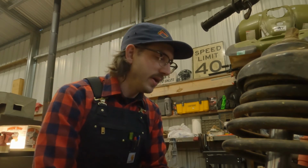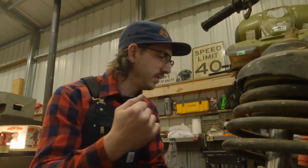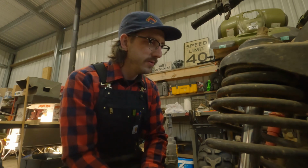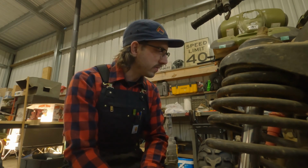The brake master cylinder is stuck in the rear. It is stuck, pushed in. You push the pedal and it doesn't even touch the piston. Loose tie rod ends up front. This thing's kind of abused, but it's all there. I think it can be cleaned up and look pretty decent.